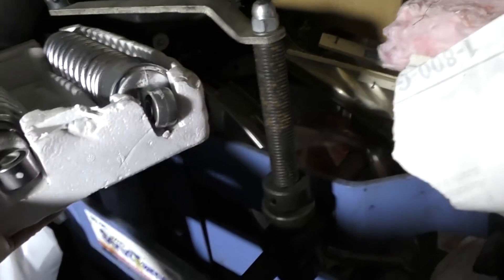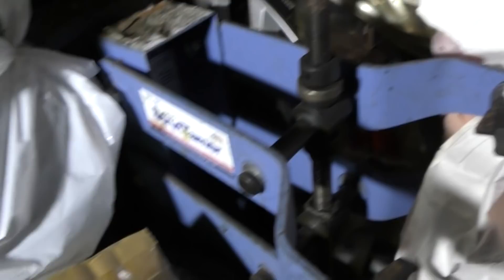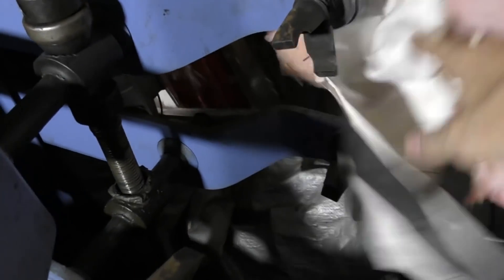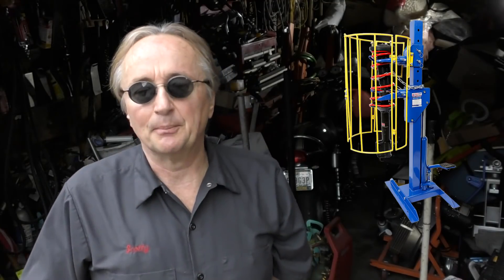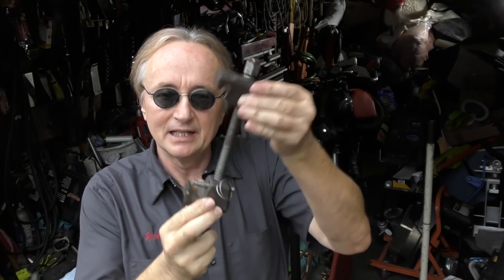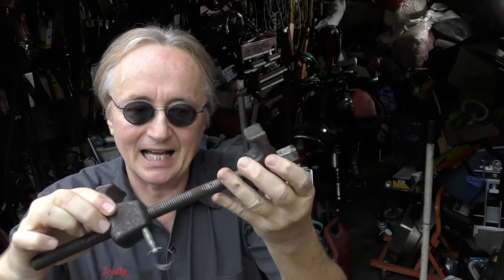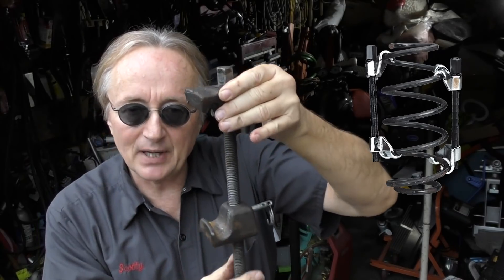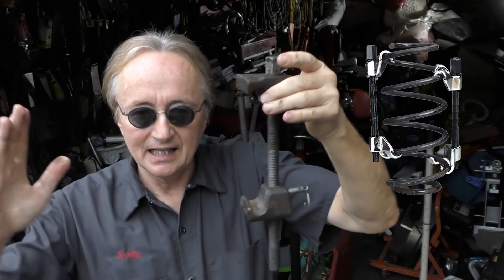Next, once I take out these old motorcycle shocks, hiding under there is a giant spring compressor. This giant machine that cost almost a thousand dollars is used to compress struts. You can certainly tell I don't use this much since it's covered with all that junk. Here's the main reason why — it's relatively cumbersome. This is what I use most of the time: these are my spring compressors. Simple technology — a giant bolt and pieces that hold on to the spring and compress it. You put one on one side and one on the other.